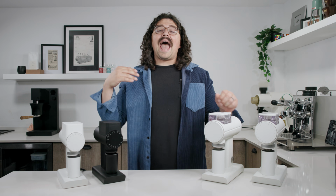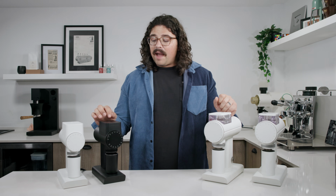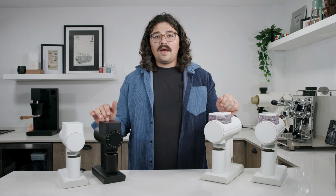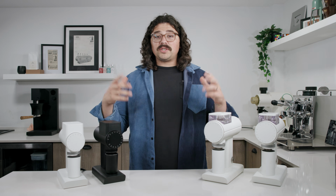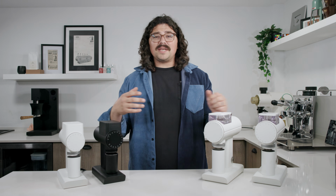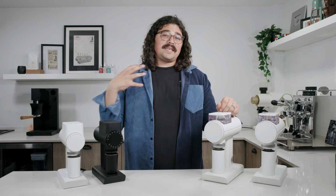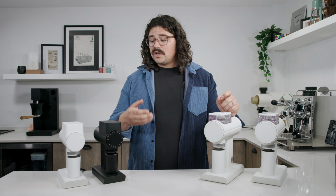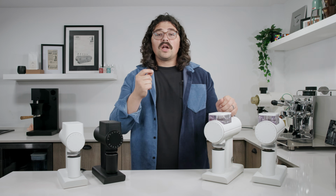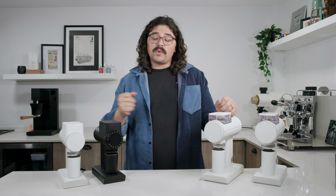Now, I would say for the absolute majority of you out there, you'll never run into this ever. And in fact, I guarantee the reason they didn't run into this in their testing, or I'm assuming they didn't, is because typically, especially in the Asian market, a lot more darker roasted coffees are used. This is the same with Italian companies and other companies throughout Europe. They typically test with really dark coffees, so you don't need nearly as much torque to chew through those. When it comes to super dense coffees that might even have a little moisture content left in them, you need a lot more torque to rip through those.